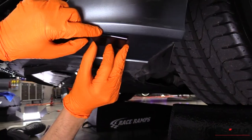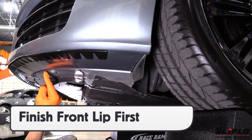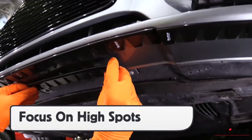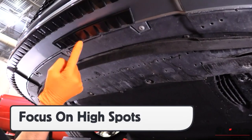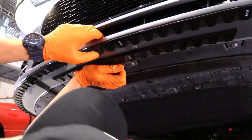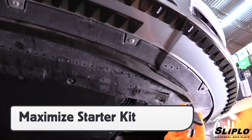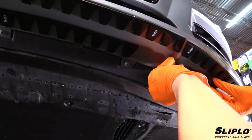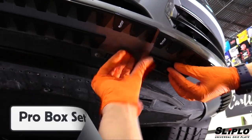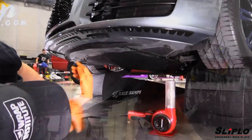Only secure the piece when the symmetry is perfect. For best results, install the front edge first from side to side, then focus on the back sections. For standard vehicles or when using the starter kit, this may mean only having three to four pieces left. With the remaining pieces, protect any spots that may get or already have pre-existing damage. Build out from the center point to ensure a professional-looking result. With one piece left, it can be cut exactly in half, then applied to finish up the box, placed on the underside of the recessed area in exactly the same spot left and right. To ensure full coverage during install, using the Pro Box Set is the best choice.